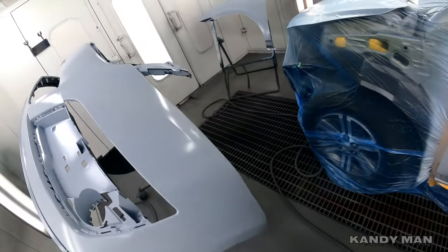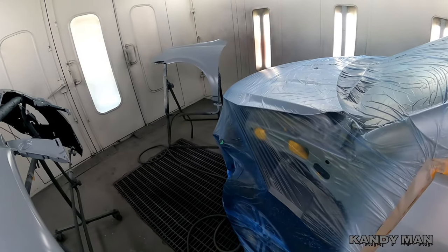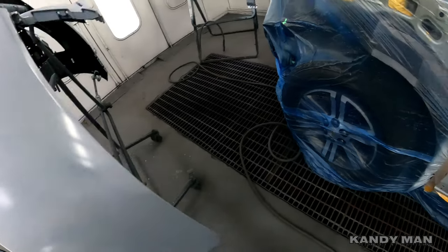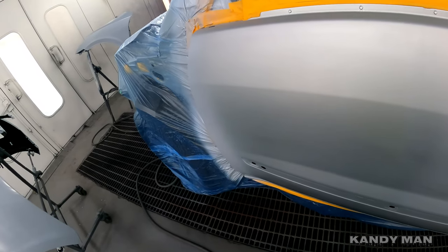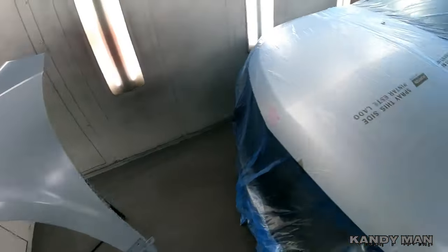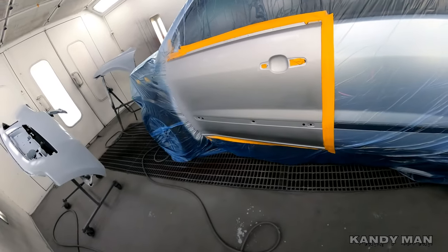We're going to get into basing it out now. You can see here I sealed the edge of the blend — I like sealing the edge of my blends so it's the same as that fender over there for coverage reasons, and also for the sand scratch. When you put base down over something that's non-sanded it's going to lay differently than on something that's sanded. I was taught when I first started spraying waterborne about 15 years ago with Enviro Base — they wanted you to seal everything because the color can actually change depending on the substrate and what grit it was sanded with. I tacked this and now let's get into using this gun.